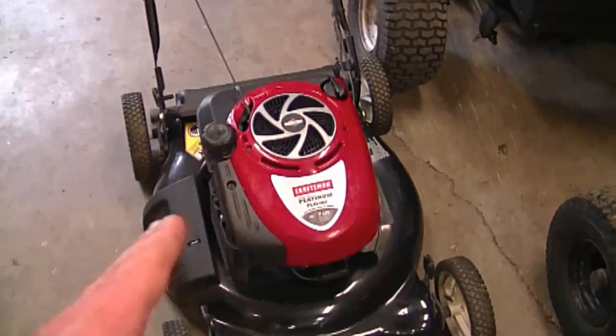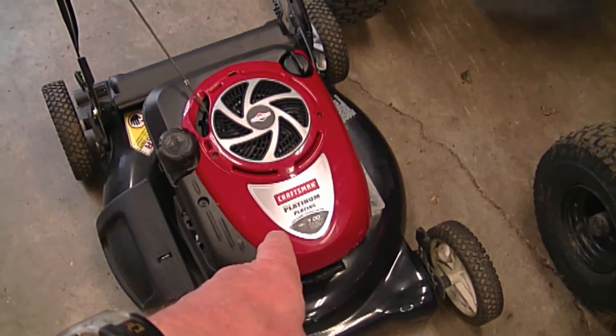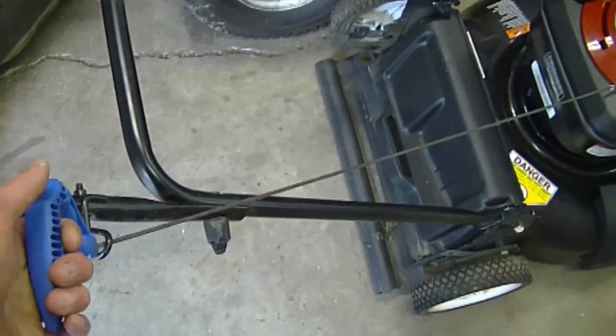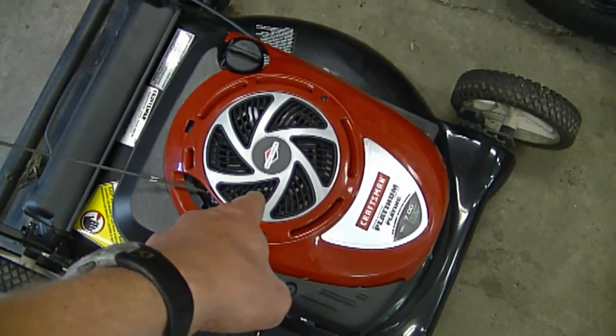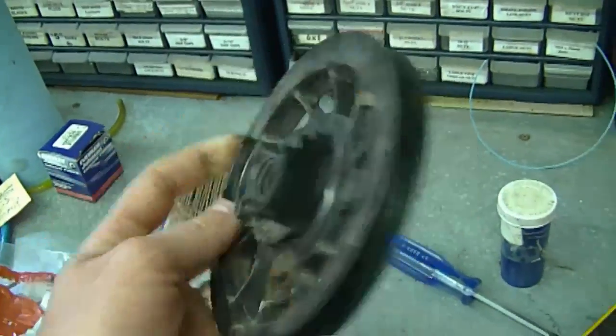The first topic I'm going to show you in the diagnosis is in regards to a lawnmower with a Briggs and Stratton engine like this. I've since repaired it since it came in, but the problem was that the cord here wouldn't retract at all. What I had to do to fix this is take the cover off and take the whole recoil shroud off, because it is riveted to the shroud that goes around the engine. This is the part I took out of the recoil.